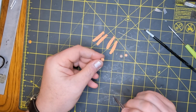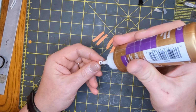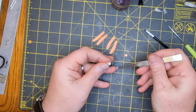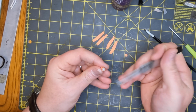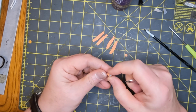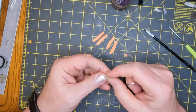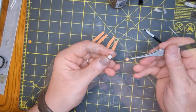Now there I'm pointing out that there's an actual handedness, or a side. So you have to make sure the propeller is airfoil shaped and the rounded part of the airfoil faces forward. So this hub is the forward hub. That's the one that would have all the screws and the bolts and the nuts to hold the propeller on. So that goes on that end, which makes sense. And then the other side, that little tiny one there, looks like a donut, that's going to go on the opposite side. And then the hub will be completed.